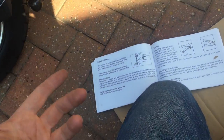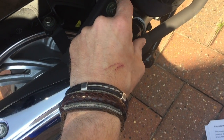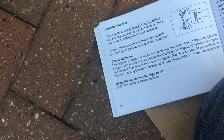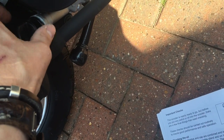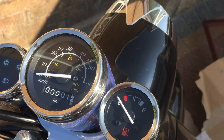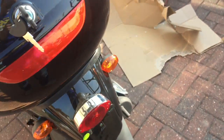Before you use the scooter, check whether there's enough oil. The oil dipstick is part of the filler cap on the right-hand side of the bike — just unscrew and remove. The recommended oil is 10W-40. You can see it's got a little bit in already — it's above minimum, which is a good sign. Before filling up, I'll turn the ignition on as well. The fuel gauge goes up a little, so there's a small amount in there, but it's worth topping up. It takes normal four-stroke unleaded — the filler is just under the seat.